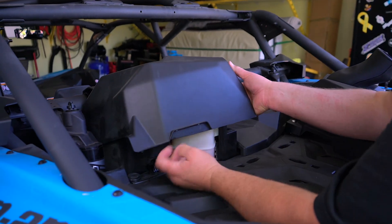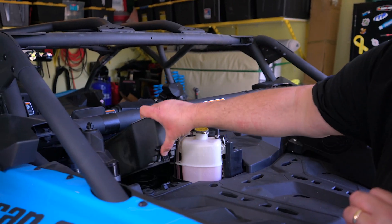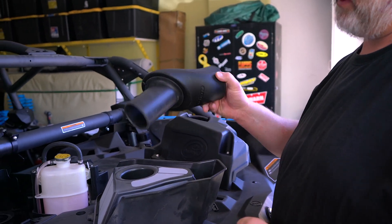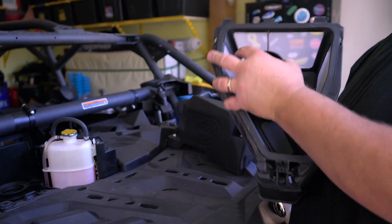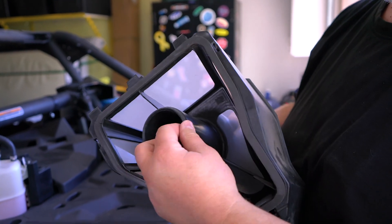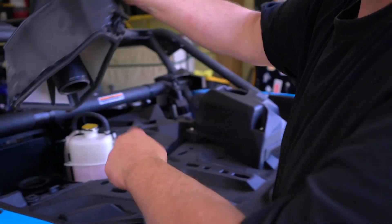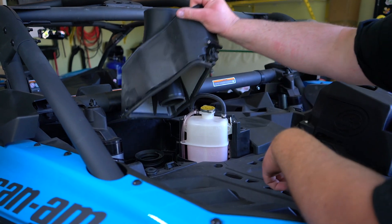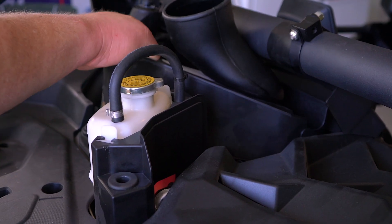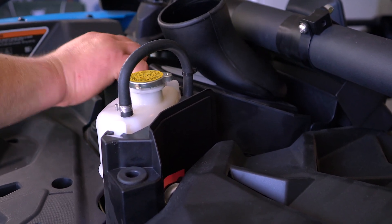For the S&B particle separator hardware install, we're going to pull off the old air box lid — this we won't use. We'll pull off the pre-filter. Now this comes in your kit — it's two pieces: a rubber piece and a plastic piece. This goes into the pre-filter, so we'll work that down. You want to make sure that this rubber edge comes all the way out; it makes a good seal. Then we can install — put the pre-filter back, making sure the tabs go back in the holes. That's locked into place.